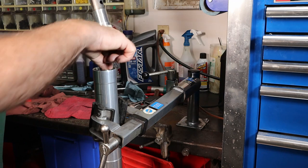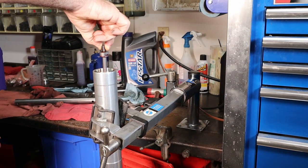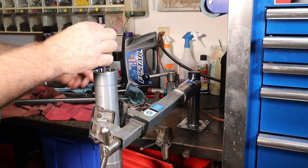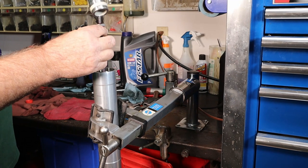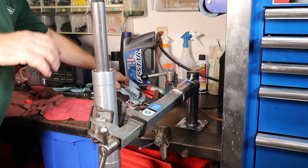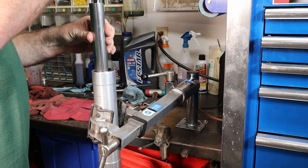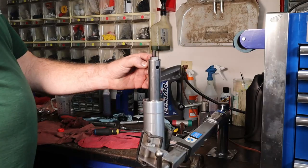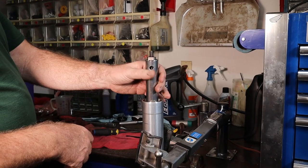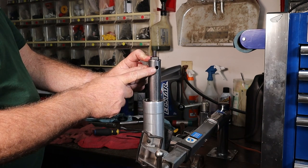Then we'll put our tube back in. We've got to run our damping rod up. Then we'll put our tube in here, and hopefully we can catch that because I don't have the tool to pick it up with here. And we did catch it. We got our spring in, and we got our tube in, and through some bit unorthodox ways, we got this clip back in. So now this is all loaded back like it was.